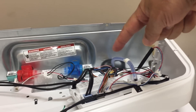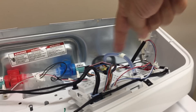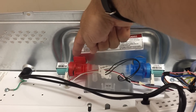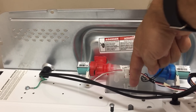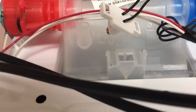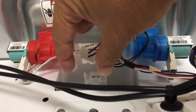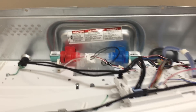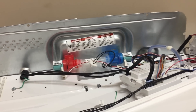This is the control panel — the computer that runs the washing machine. The circuit board costs more than this entire washing machine did. But the critical piece is where the hot water flows in and where the cold water flows in — and in between is this temperature sensor. It sits right in here with two tabs that have little hooks on the sides. Just get a flathead screwdriver in there to release those hooks and pop out the temperature sensor. Once it's out, the machine no longer thinks the water is too hot and will run pure hot water.